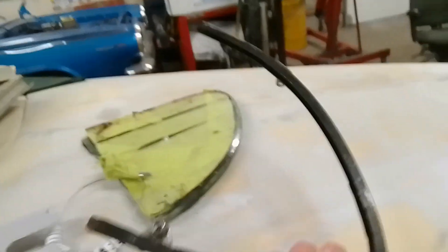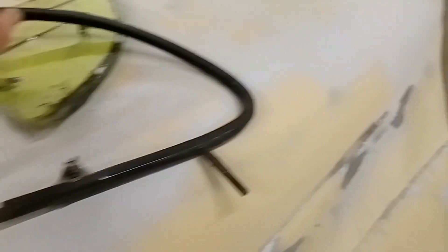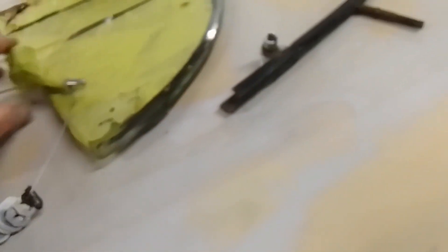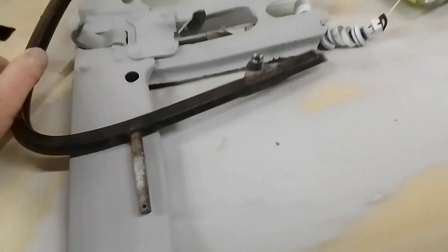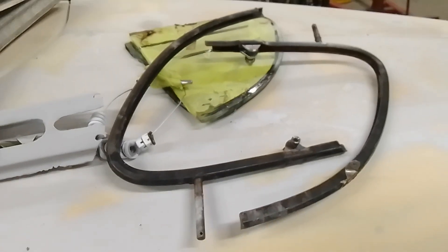I'm getting ready for my glass, so I took out these quarter windows — that was fun getting the glass out. These do need to be cleaned up a bit; I'm gonna get the sandblaster working and clean all that up. There's a latch on this one; the other one was broken so I basically welded that in so I can put another latch on. I also noticed this driver's side is chrome — I'm missing a rivet there, but it's riveted in. The passenger side isn't original, so I might just paint them both black to keep them the same.